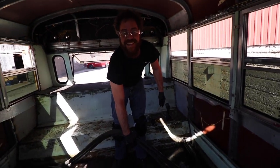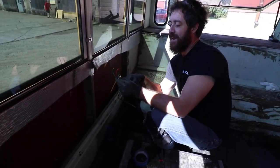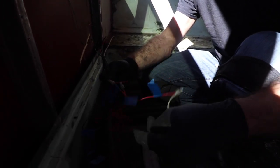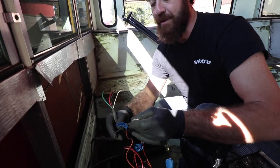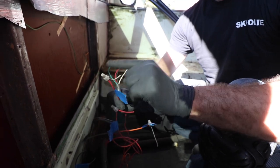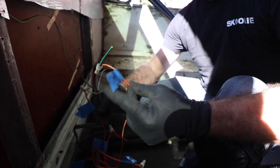You're probably thinking: what about the heater wiring? This big gray cord runs all the way to the front of the bus and is the power cord - we've got four wires coming out of it: black, red, and green. When it was plugged into the heater, all that's coming out of the heater are orange and red. What I ended up doing was labeling each one that I cut - labeled it black, labeled it red, this one's also red but labeled white with tape and left a section of the wire it was connected to as a visual reminder. Same for green on an orange wire.